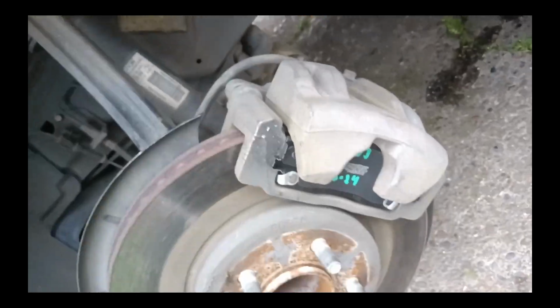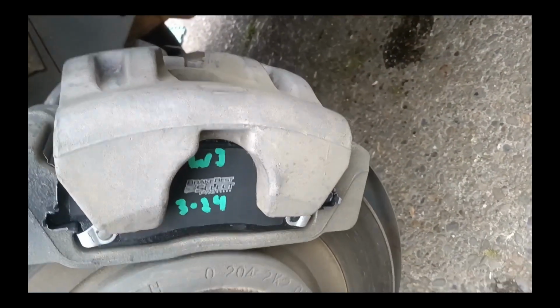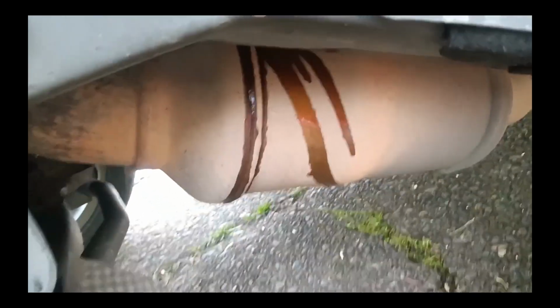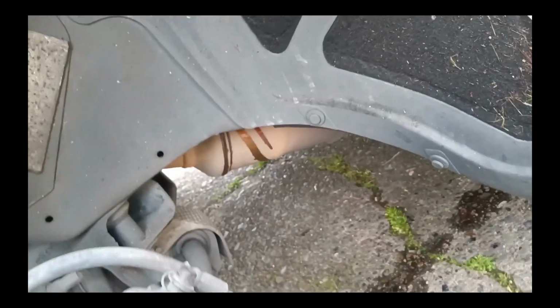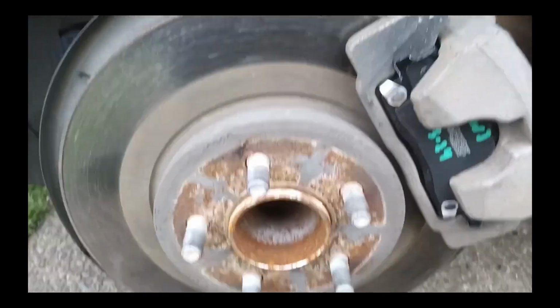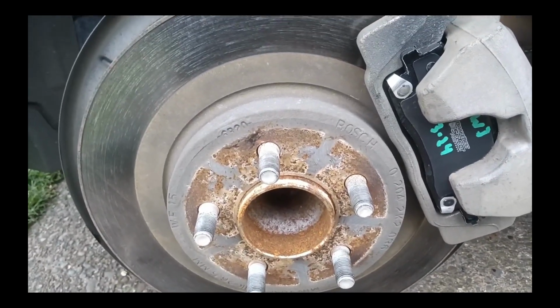Rock on. Eventually, we got 4 corners looking beautiful here. Signed, dated, all installed good. Got the fluid level about right for initial testing. Looks like I need to wipe that off right there. We did go a little high on it. That might stink a little bit, so I'll wipe that off. I'll inform the customer there might be a stink. Then I'm going to go bed these things in. We'll test it out. I'm always the first one to push the brake pedal, folks.